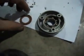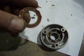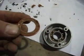And this is all the grease I got out of that other bearing. Some of it, you can see, is just hard. I mean, it smacks the paper when it comes down. And then this stuff, that's not really grease anymore either. It's all hardened up. So it's just crappy grease from Porter Cable that dried out.